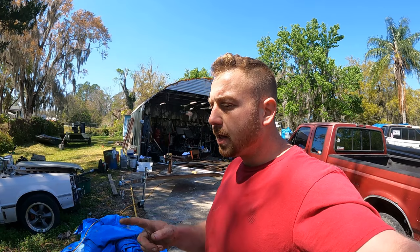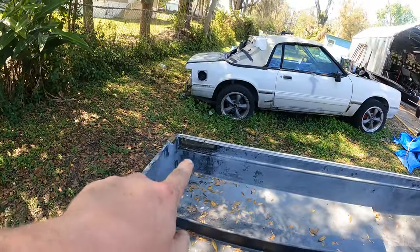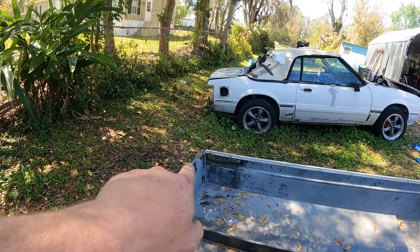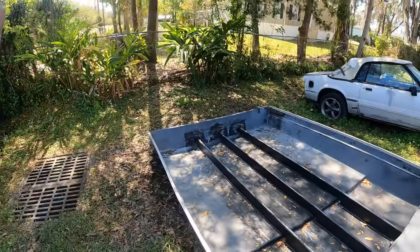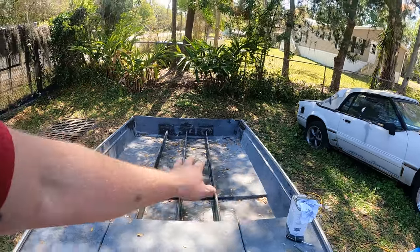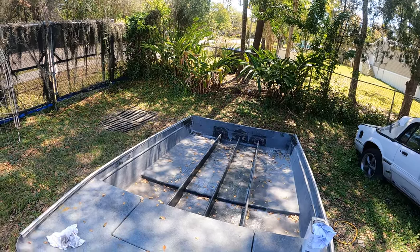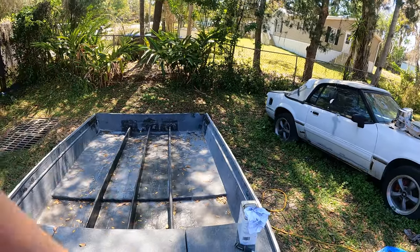That's what we're doing on the inside of the boat, then I got to flip it over and work on the outside to get it paint ready. We got them glassed in — got that one in, that corner in, and that back piece — I forgot to mention it was busted, so we put a patch on it. Let them set up, and we're going to flip the hull. Not going to grind or clean those till we go back to the inside to get it ready for painting, but we're doing the outside first. I just want to get those done so when I'm on the outside I can fill the holes from there with glass and bondo.